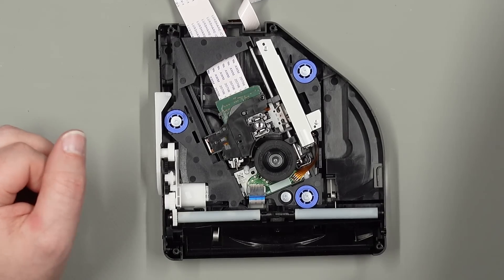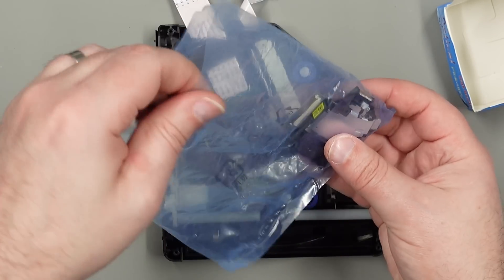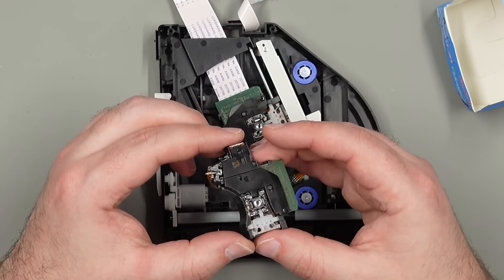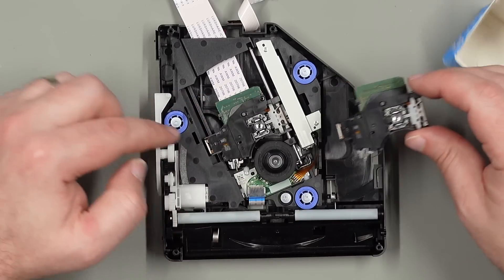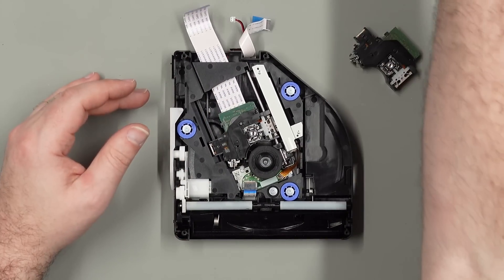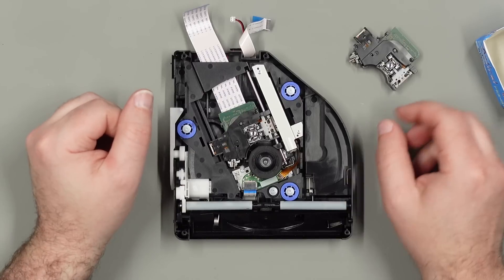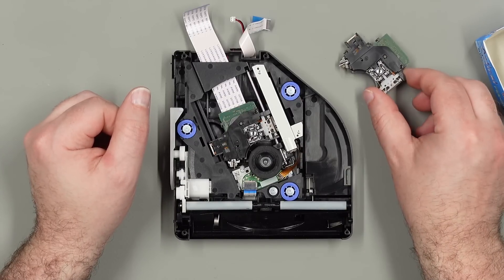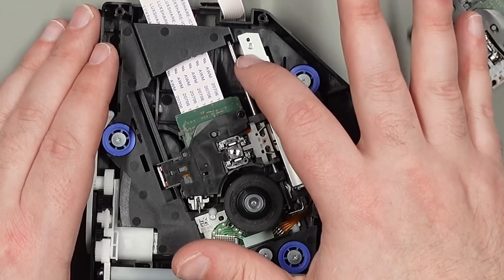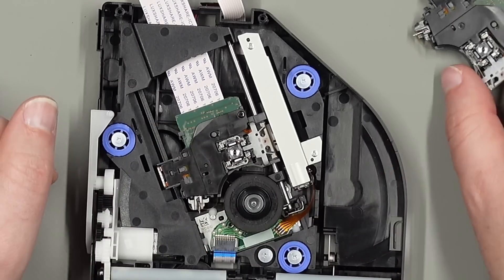We're back to where we were. I do have a replacement laser assembly here — I'll leave a link in the video description to where you can find these. This came with the PS5, so the owner already bought this laser unit. All we need to do is swap this part for this part. You may also find places that sell the whole assembly with the top cover, but remember you must keep the original PCB that goes with your PS5. The actual laser assembly alone is going to be cheaper but a little more fiddly since we need to get the old one out.